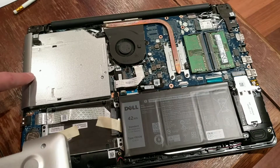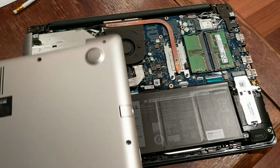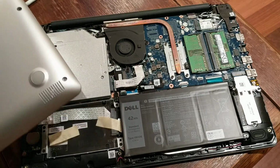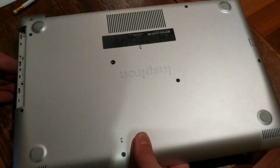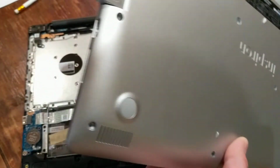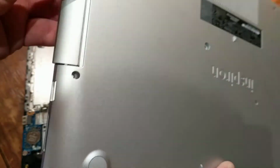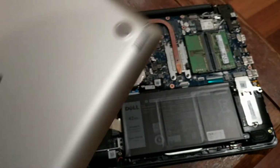So this is actually the underside, obviously, with the optical drive in place. Once you've taken that screw, you can see where it locates inside this unit there. There's my clock declaring 3 o'clock. It's on time again. Right, but when you pull the drive out, let's just pretend this is put back together, you can see that will actually be inside there. That would actually be stopping you from pulling this out. So you have to pull the drive out to be able to remove the top.